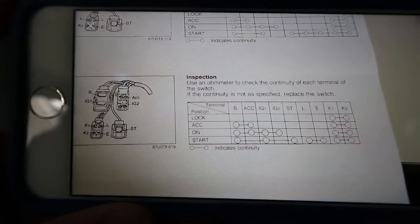We had a little bit of an issue when we first wired it up because we were looking at the wiring diagram for Mazda and it turns out it was wrong. Good job Mazda from the 80s. I don't exactly remember which color wires were which, but if you guys want to do this, you can pull your ignition switch and on the side of it there's a label showing what every single wire is. That was the correct diagram we used. Here's a picture I'm going to show you guys on my phone - this will show you which wires are which and what all needs to be connected.